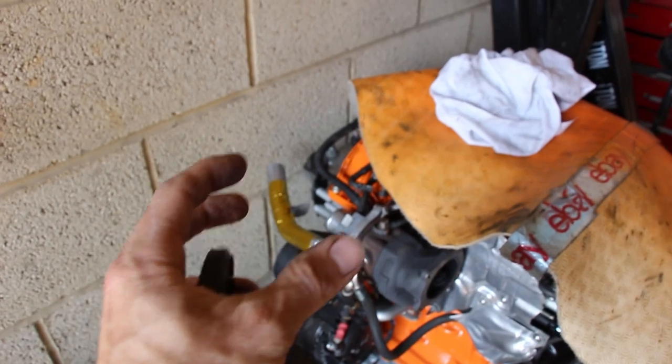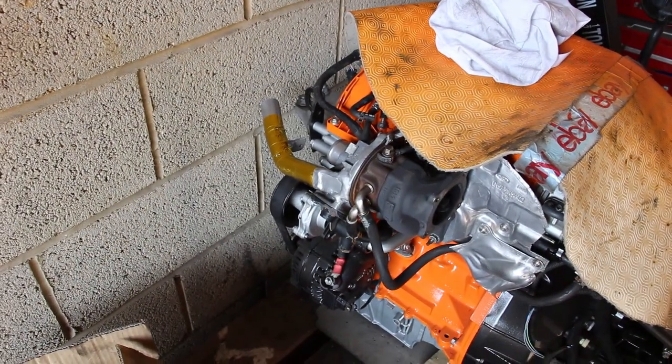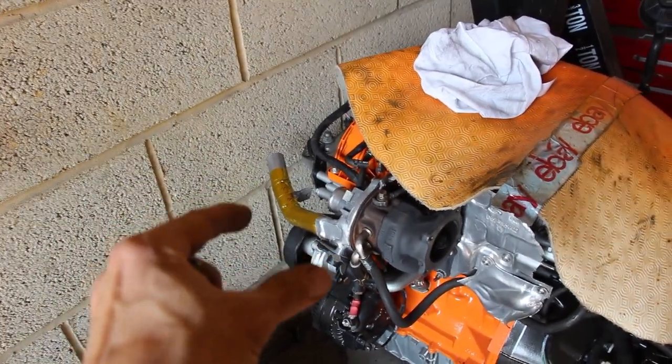There is fresh air coming in here, but the general engine bay temperatures are going to be pretty high, so anything to keep those temperatures down will be good. Pointless if this pipe is warming up to then blow even hotter air through the intercooler. The intercooler has to do even more work. Return goes straight into the engine, so that's fine. Run out of paint, so we'll clean up that later.